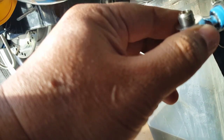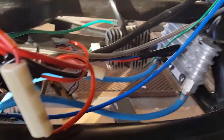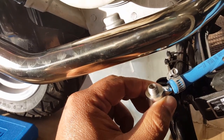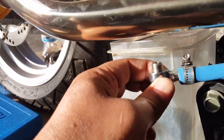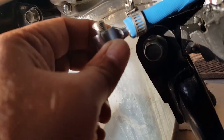It still feels like it's tilting a little bit clockwise, so I'm going to tilt it this way a little bit. You can play around with it until you get exactly how you want to position it. I like to make sure there's no strain on the cable being twisted. You can see here it's a straight line from the output of the oil cooler — what I call the radiator — coming out here to the input of the adapter. Cool oil going into the input, straight up and down now.